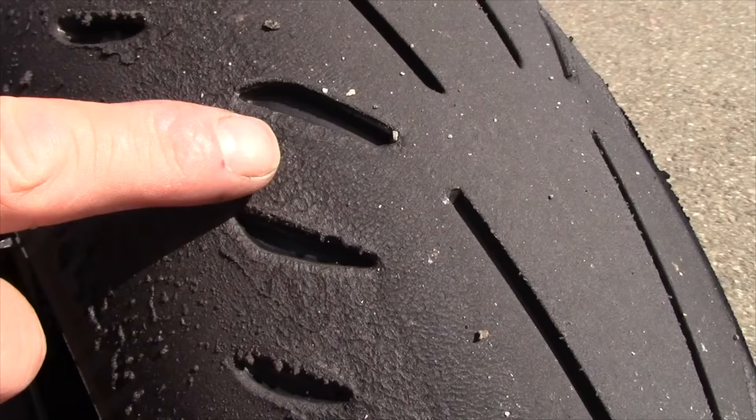This is the contact patch. As far as a Dunlop carcass goes, it's very hard — when you sit on it unmounted, it doesn't buckle at all, so every imperfection of the road comes through the tire to you as the rider. With the Pirelli, which is a much softer carcass, a lot of that feedback is either missing or hidden because the carcass absorbs more of the bumps and imperfections and does not relay them through to you.